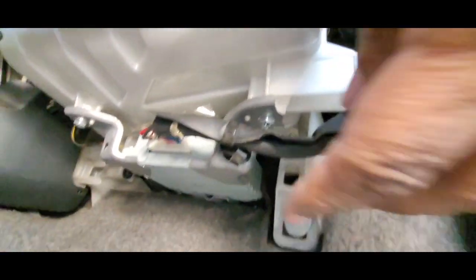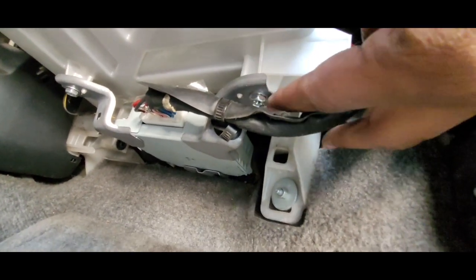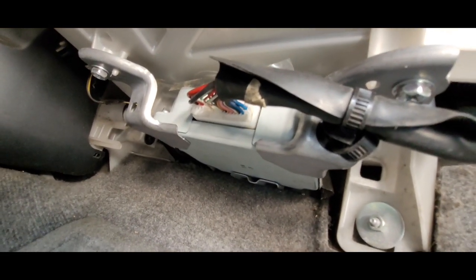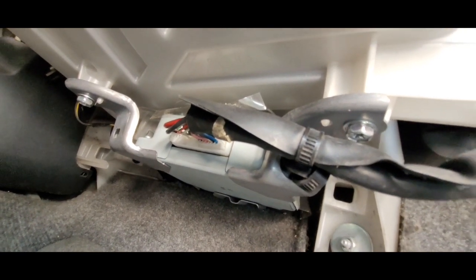You'll see two bolts here — one here, one there. That's either ten millimeter or you can use Phillips. You unscrew those and it falls out. You'll see there's a little hook in here — no big deal, this goes right in there. You put the new one in, screw it back in, plug that back in, and there you go. Then you just want to do a restart on the computer — your whole car — and then it should refresh everything.